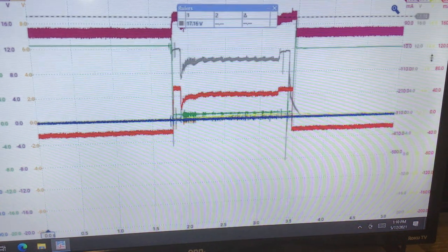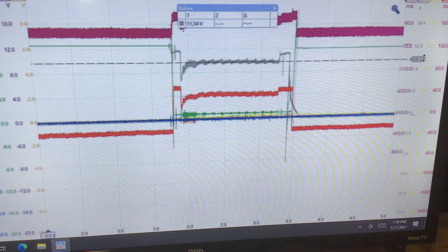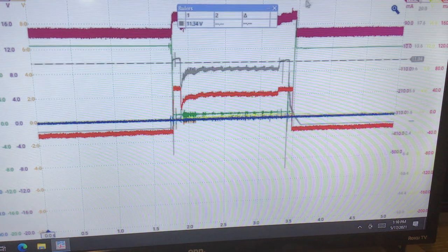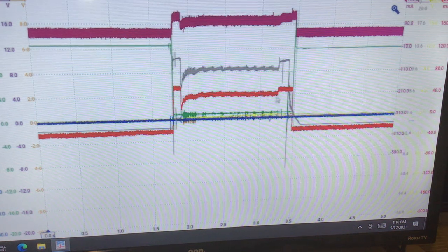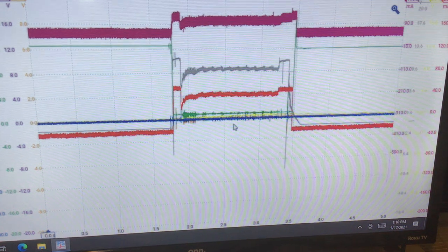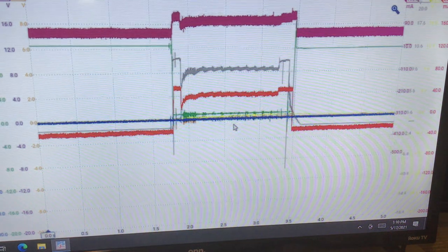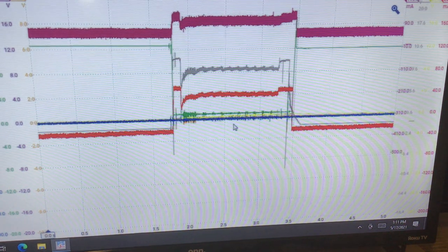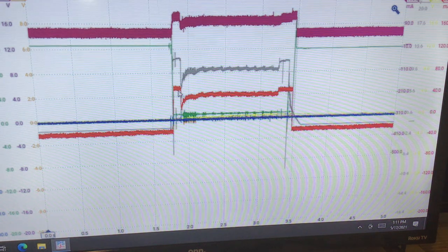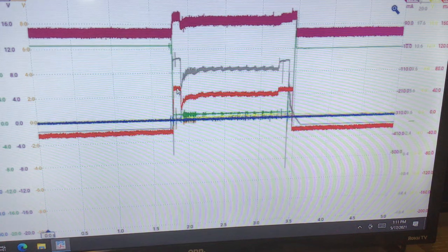That is right here. That is the ignition switch, and that is getting power. The car is cranking right there, and you can see we're at cranking voltage on the gray. The ignition coil relay is being grounded by that driver in the PCM, called the logic driver at pin E7, because it's definitely proof of that. As you look at, this is current flowing through the ignition coil relay.